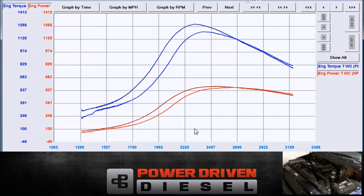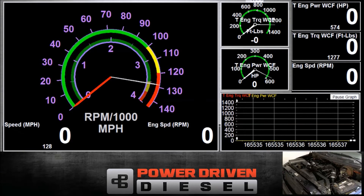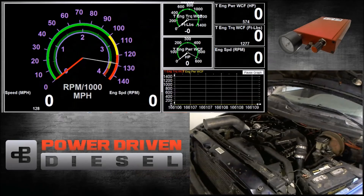Let's see what it does for response time now. Let's go over there and do our 5,000-pound load. We're going to go from about 1,800 RPM to 2,800 RPM and see how it does time-wise. Here we go.